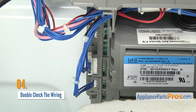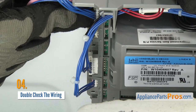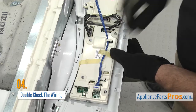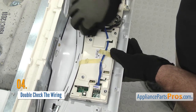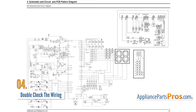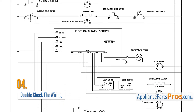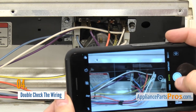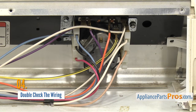If you've just finished a repair job and you're still having the same problems, or have encountered a host of new ones, start by checking out your wiring. There are a lot of plugs, terminals, and ground wires to be aware of when you're replacing faulty parts. Double check to make sure all the wires and wiring harnesses are connected to the right terminals. Also be sure they're tight and pushed in all the way so you have a good connection. Even if you think you did it right, it's worth giving everything another look and checking it against pictures or wiring diagrams. Consult your appliance's manual or check online for official wiring diagrams. And the next time you complete a repair yourself, remember to take a picture of wiring arrangements and complicated component assemblies before you disassemble them. This will give you an easy reference for how everything should look once you're putting it all back together again.